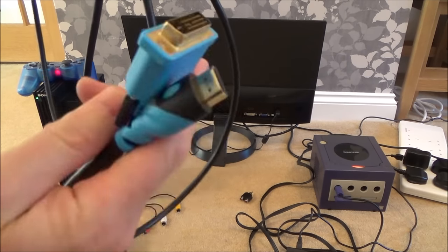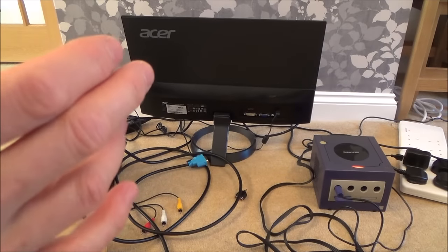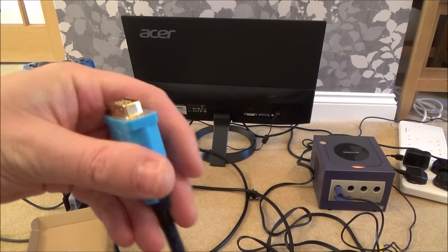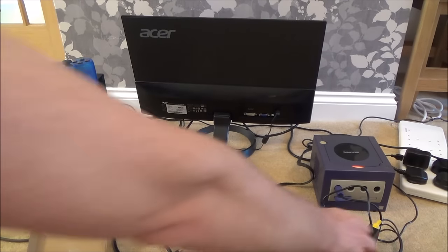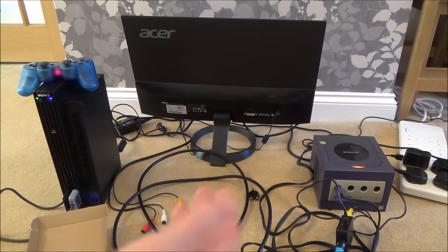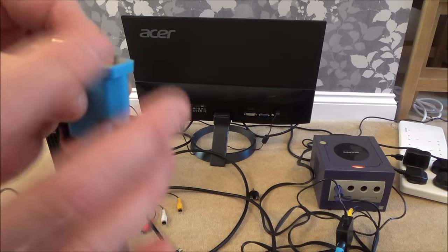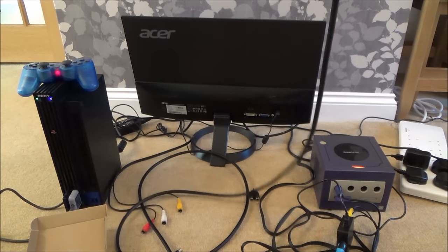You don't need to spend a fortune on these leads because remember it's a digital signal — so if it's going to work, it's going to work as well as a hundred pound cable. If you get a two or three pound cable, although it's not going to be made as well as a really expensive cable, the picture quality will actually be the same because this box has turned it over to digital. Beforehand when it was composite all the way into the TV, the cable did make a difference because it was analogue. But now that we've gone to digital, it doesn't actually make a difference. The cable will look nicer and feel nicer if it's more expensive, but picture-wise it will be exactly the same. So don't think that because you've got a 50 pound cable you're going to get a better picture.